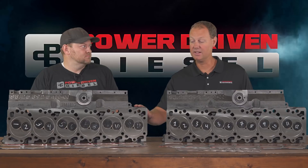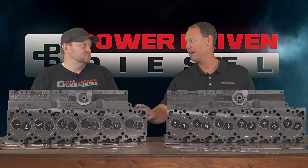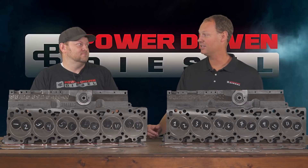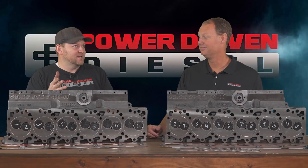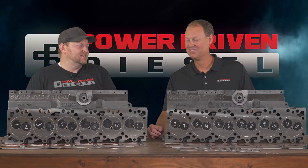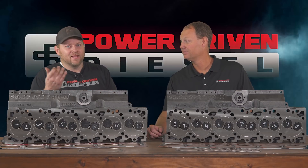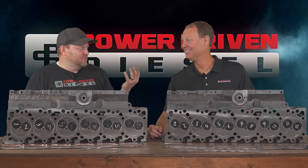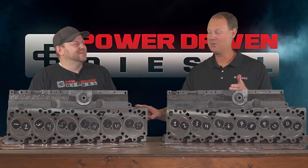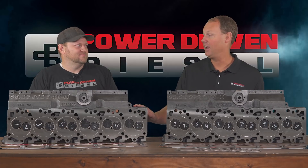Even on stock heads, if I was putting a new head on anything I'd never put it on without an o-ring or fire rings, because I know the potential is there and I know eventually it'll make more power and I'll be back in there pulling the head off. I'd never personally build an engine for myself without o-rings or fire rings. On my junker drag truck I blew seven or eight gaskets — started with stock, then o-ringed, tried various stud brands and torquing techniques, kept timing conservative, before I finally wised up and did the fire ring setup.